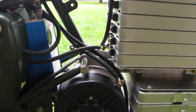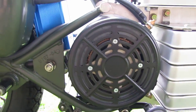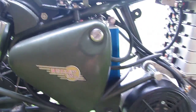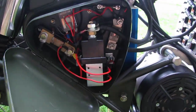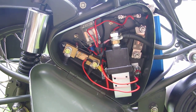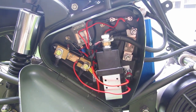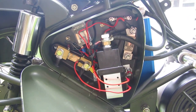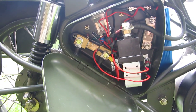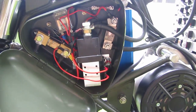The right side looks much like the left, except that you'll notice the right plate goes around the motor. That's not necessary to brace the motor on the right side at all — it's a shape and size and weight that can be mounted only with those four bolts. On the right toolbox, you'll see the other electrical components: you've got the contactor there, a main fuse, a smaller fuse with a diode right after that, and a 12-volt relay which allows me to turn a 12-volt signal from the handlebar switches into a pack voltage signal to turn on and off the contactor properly. In the aft part, I have a shunt resistor, which the Cycle Analyst needs to estimate how much current I'm using for its data taking.